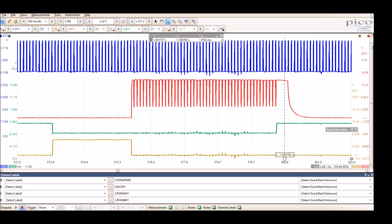The only thing left is the red trace. I think the red trace — injector CK1 — is actually the feedback from the injector module to the ECM to confirm that the injector has actually fired — basically confirming the integrity of the injector circuit.